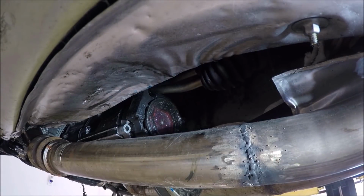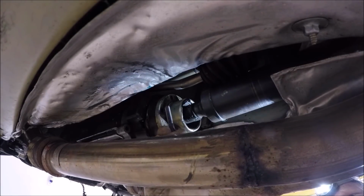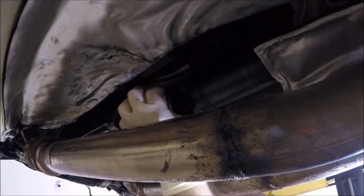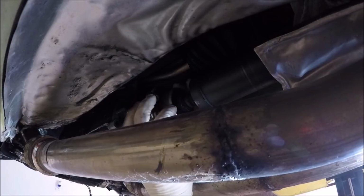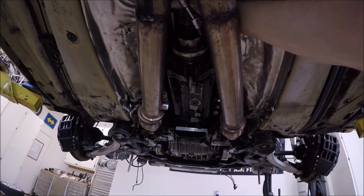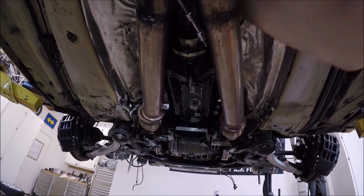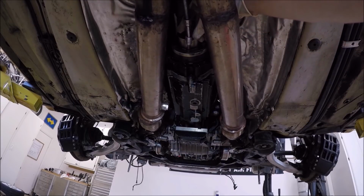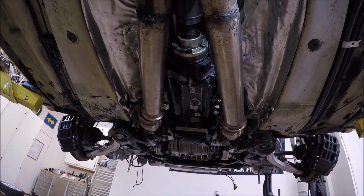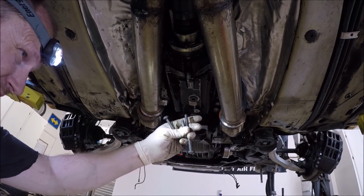We're going to do the drive shaft next. One thing you guys need to make sure you do is clean your nuts and bolts. Don't forget your retaining clip and some Loctite. Now you want to put these bolts on tight, but not too tight, because if you strip them, it's not fun getting off. Go back and double check, make sure they're tight, and we'll move on to the next thing. Next is installing this bottom plate. These two bolts, they're 45T.